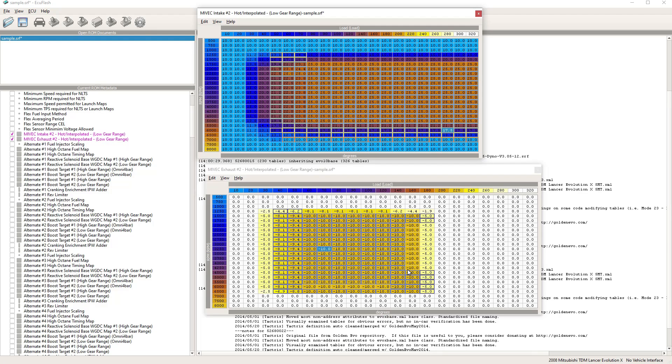Please keep in mind this is what I do — there's a lot more going into this: a lot of data logging and driving. The dyno is like the last piece my videos show, but there's about an hour to an hour and a half of street driving and manual analysis before I do anything. MiVec for power, I think, should only be done on a dyno — because the difference between 25 and 30 degrees might be negligible, or sometimes it even loses mid-range power when you increase MiVec, and you wouldn't know that on a street tune.